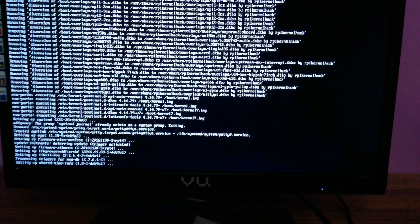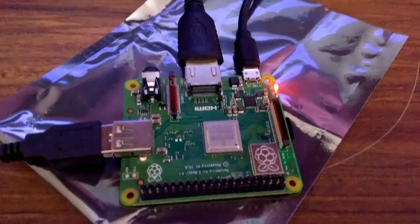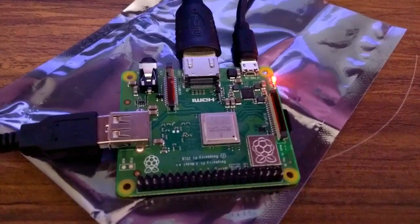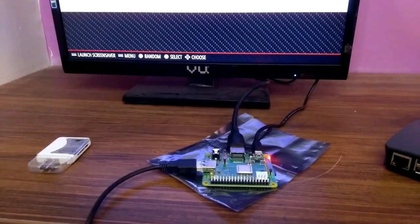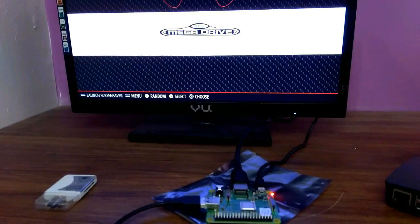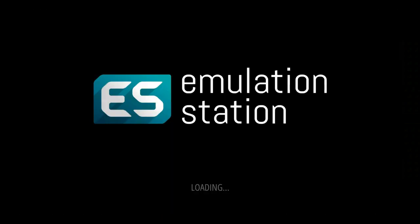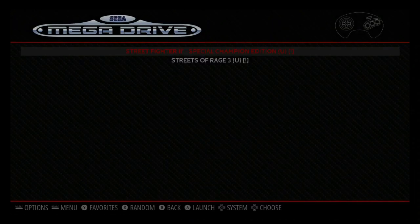You run the command from the terminal. Make sure you are connected to the Wi-Fi from your Raspberry Pi 3 or 3 B+, and this is how it will run for a few minutes. Once the process is completed, you can take out the SD card from your Raspberry Pi 3 or 3 B+ and insert it to your Raspberry Pi 3 A+. Mine is already ready as you can see — I am connected and RetroPie is up and running. RetroPie is starting up on Raspberry Pi 3 A+. I will be testing 3 games: one Mega Drive game, one Neo Geo game, and one PlayStation game, and show you the performance.